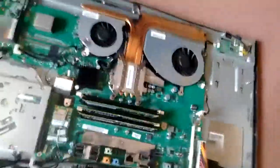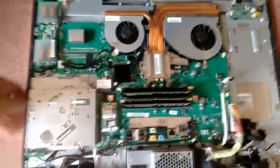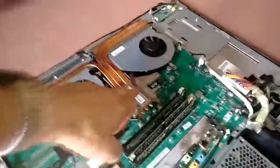When I got this replacement and started it up, there was a little battery called the CMOS battery, and that was flat. So every time it started up, it prompted you to enter some information. It's actually behind this thing — you've got to take this drive off, and then go right under here under these cables. I had to take all this board out and lift it up, take these fans off, take out the CPU, just to change a battery.